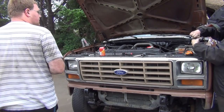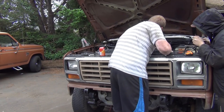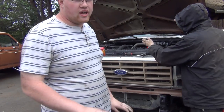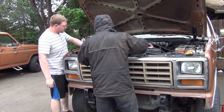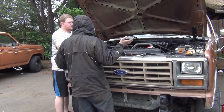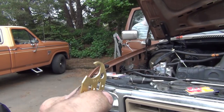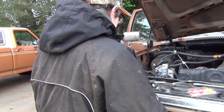We're getting close to driving. We already swapped out the steering shaft; power steering ran for a little bit. The fuel system — I just hooked the hoses up, put a little adapter on, it primed itself and fired right up, didn't even skip a beat. We're going to put one of these on the battery post — a spade connector — so we can just plug our cab power to it and it'll make everything a lot simpler.